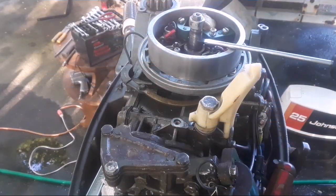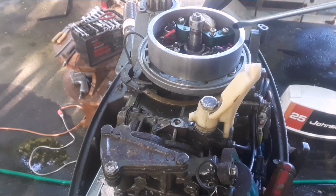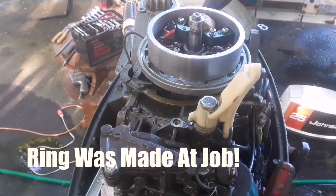This special ring is what you use to adjust the coil gap to the flywheel magnets. It's pretty hard to do it without it, but you can. Since I have the ring I use it. This side was out further than it was supposed to be, causing a minor problem. This is what you do to adjust it properly — just wanted to show you the ring.